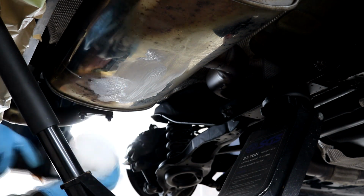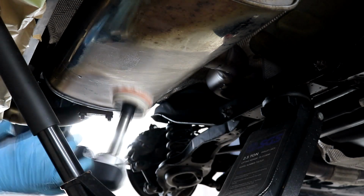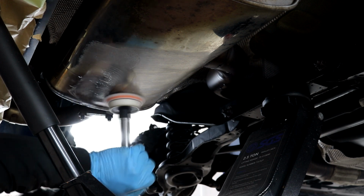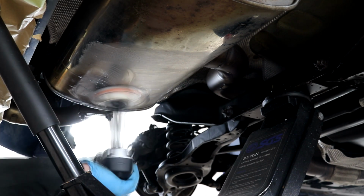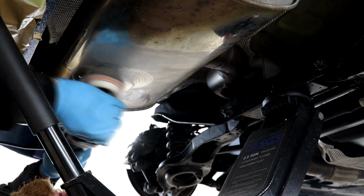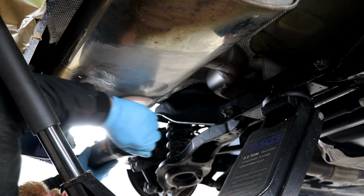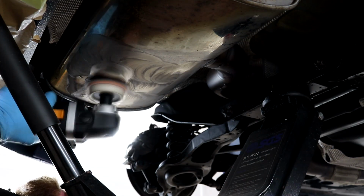We tried compounding, wet sanding, compounding again, metal polish, wire wool, the rotary machine, the DA, in fact everything that we did have at our disposal, we tried it. The exhaust must have had 5 or 6 hours of solid attention, but I was happy with the efforts that went into it, even if it isn't 100%. The exhaust was refined and ceramic coated shortly after, and it should now stay nice and shiny and easy to keep clean.